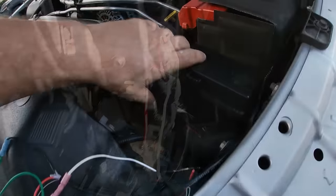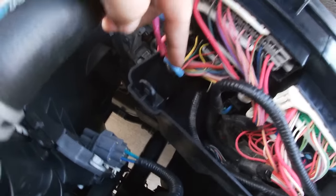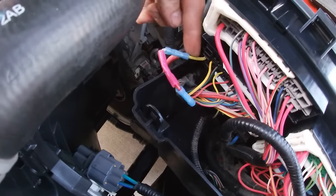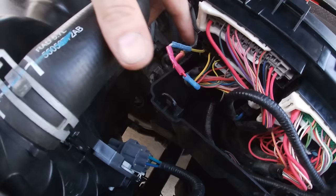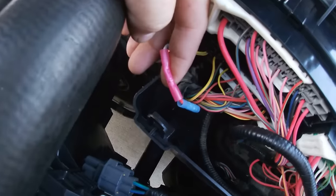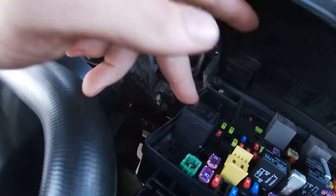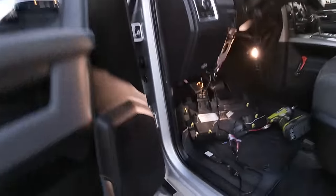This is temporary because I don't have any more blue heat shrink connectors. These are not heat shrinks anyway — mine is a much bigger wire, about 14 gauge. The white wire they had on here on the end of the connector is probably about 16 or 18 gauge. I want to put a bigger wire back on eventually, but for now just to get this thing running, I cut the red wire, cut the white wire, put a heat shrink on here — haven't shrunk it yet because I want to make sure it runs first. I put my relay back in the box — the one that was in there to begin with.